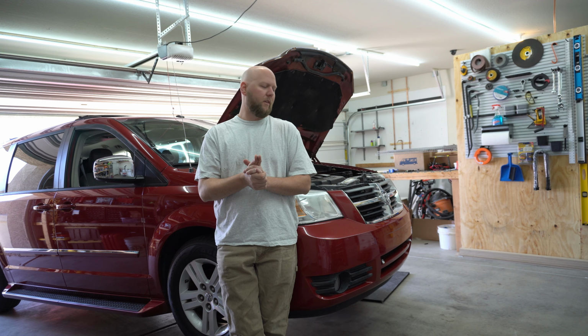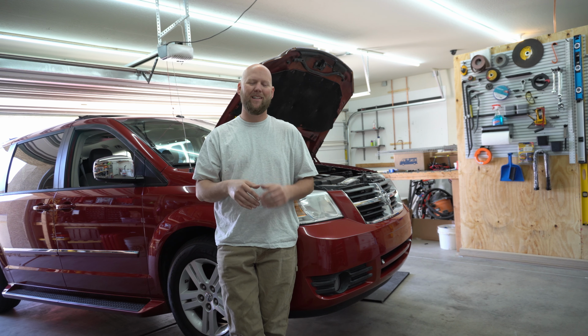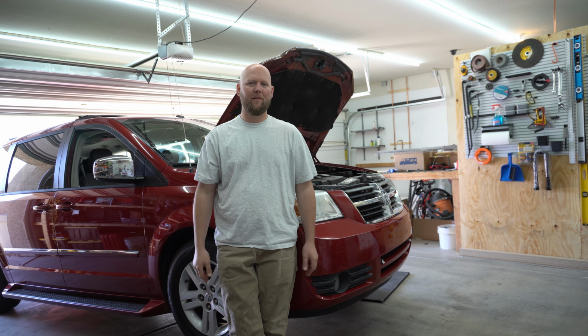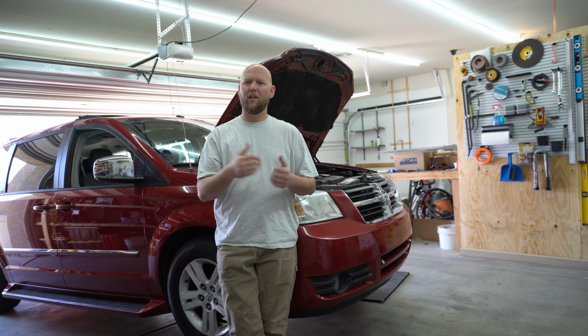At this point, all you really got to do is start up the van, let it idle for a few minutes on the ramps, go under, check, make sure you're not gushing oil and dripping. Take it on a test drive, come back. When I say test drive, I mean 5-10 minutes, nothing big. And check the dipstick after the oil settles. So give it 15 minutes when you get back, check the dipstick, make sure you're good.